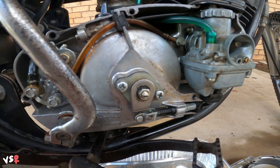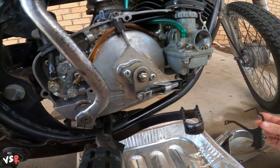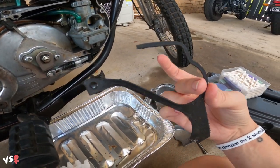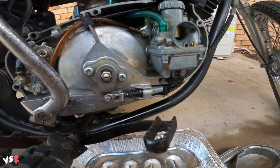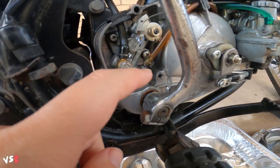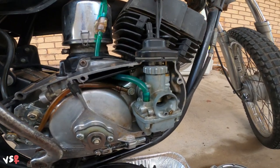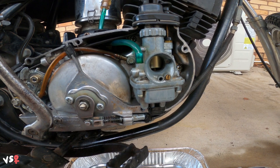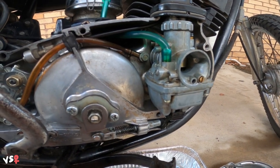They've tried to glue the casing back on, I guess, because of the gasket. The gasket seal was ruined, so I'll replace this. I'll have to replace this, and I guess I'll still open up the carby and see if I can see anything else in there that needs to be cleaned or whatever.